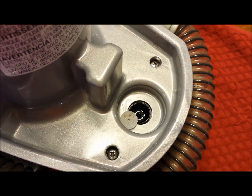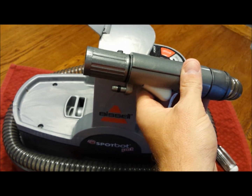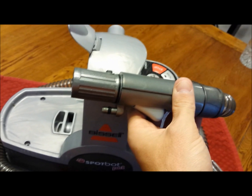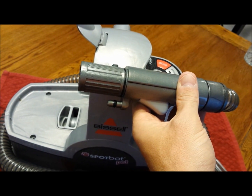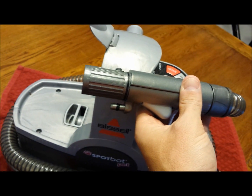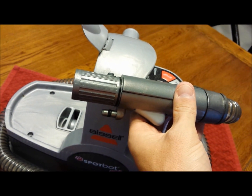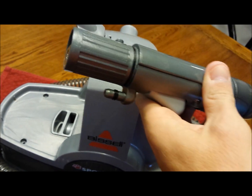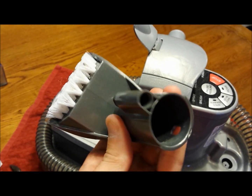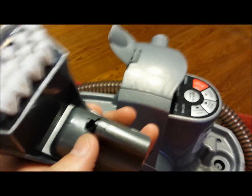If you're having no solution coming out of the cleaning chamber jets or the hose attachment, it's likely there's a blockage before it splits into both. The button here sprays solution which comes out a hole and goes into your attachment through that hole and out the black piece.